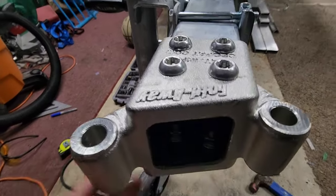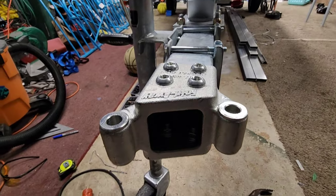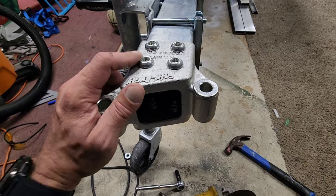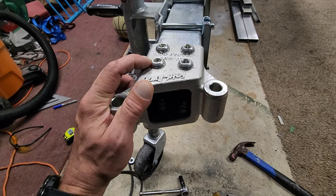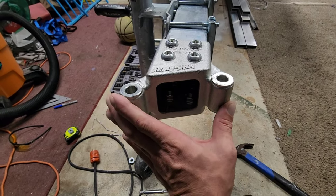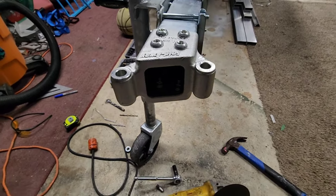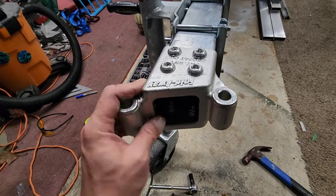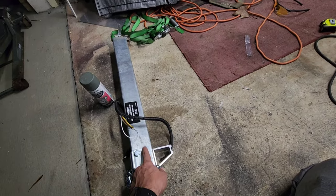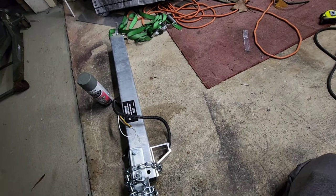We got this piece attached and I got all four of the nuts on the bottom and the top inside of there. I put these on with a little socket set. I am going to come back because you've got to torque these to 75 pounds of pressure. One thing I forgot to mention: you want to make sure you put the male piece on the actual trailer itself. The tongue is going to have the female receiver piece. I'm going to take this other piece over to my dad's garage next door — he's got a drill press — so I can drill these a whole lot easier.